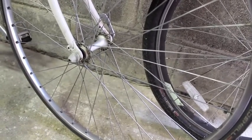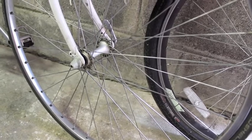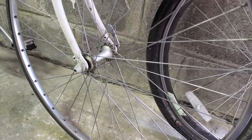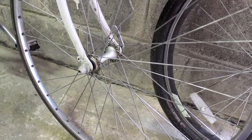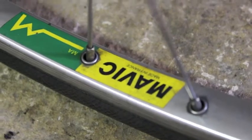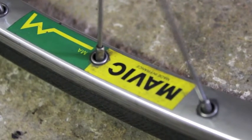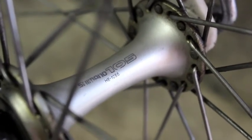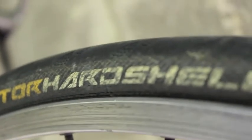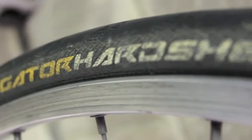Wheels — usually on all the old bikes I find, the wheels are pretty clapped. You're probably going to have to get new wheels, but it's still very easy to get them at good prices. Usually back wheels are the worst. If the owner is telling you the wheel is good, check all around the rim — make sure there are no splits or cracks, and make sure all the spokes are in. Some wheels last well, like these Mavics, which must be easily 25 years old and are still perfect. Check the hubs for cracks and splits and make sure there's no rumbling from the bearings. Pass on tires because you're going to have to change them anyway.